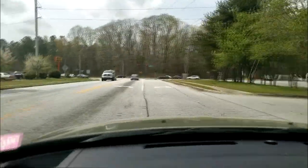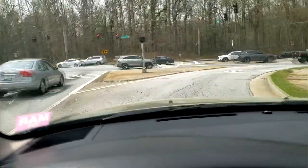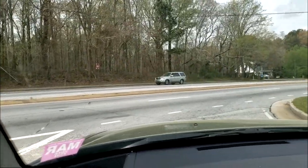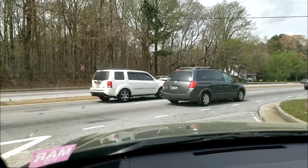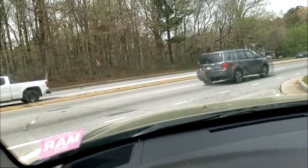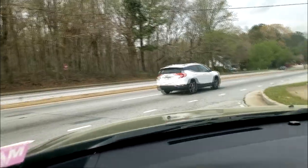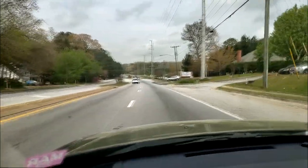We're gonna go drive it and we're gonna see what happened, guys. Stay tuned. All right, guys, I am on a test drive. I'm test driving this Magnum. You remember the Magnum that they just came in and simply said they want cam and crank to be relearned. The only way to accomplish this, guys, is you have to have a scan tool, or scan tool functions, and that is what we have here. Now it came from another shop, so I assume the car got fixed at another shop. But if that was one last hurdle that shop could not accomplish, it may be time for that shop to invest in a scan tool that can do such.